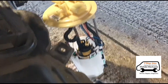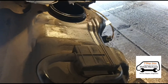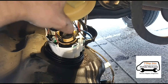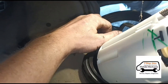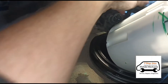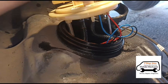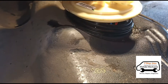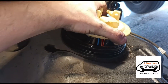I've swapped it around for the new tank pump, and we will just now slide it in. We're just going to tilt it back so we can get the float in. Get the float in like that, and then we'll tip the rest of the pump in there. We might need to get around the back and move the fuel lines so they're not catching, and then it should just slip straight in, lining up with the fuel hoses.